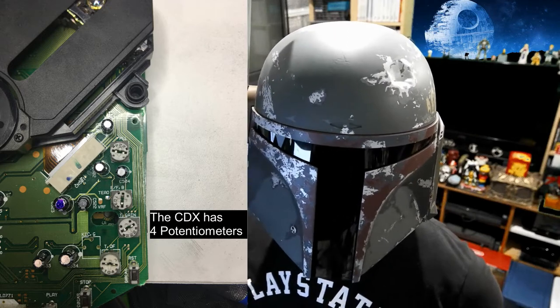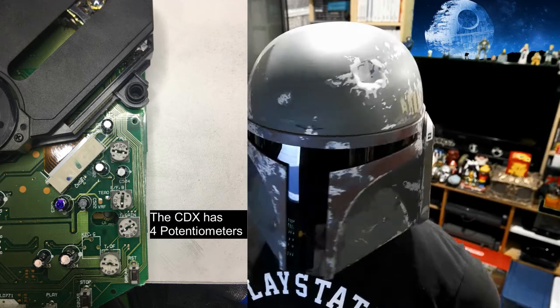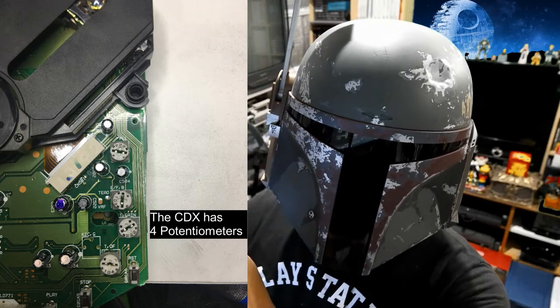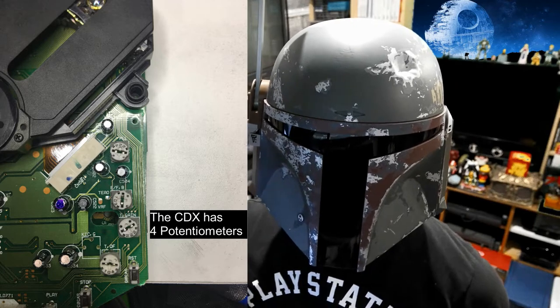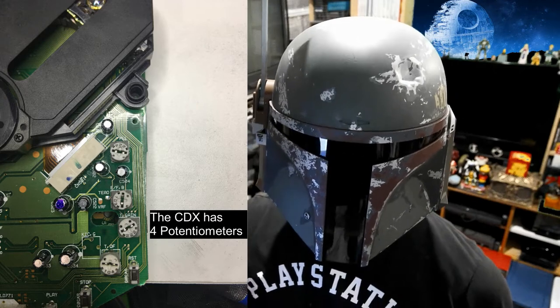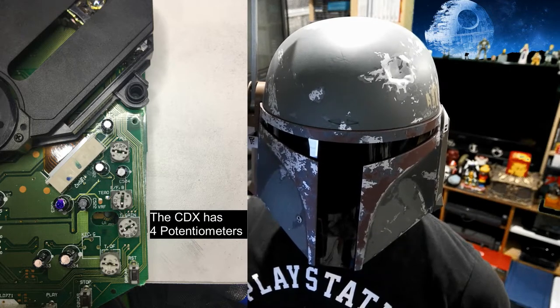Messing with those dials is very difficult. I did it with my Dreamcast and you really can't eyeball it. I hear a lot of tips online saying just move it slightly one eighth of a turn — it's going to be very impossible to eyeball. What you're going to need is a multimeter, measuring the current on those dials and making a note of it so that when you need to bring it back to the default setting, you can use the multimeter to restore each dial.